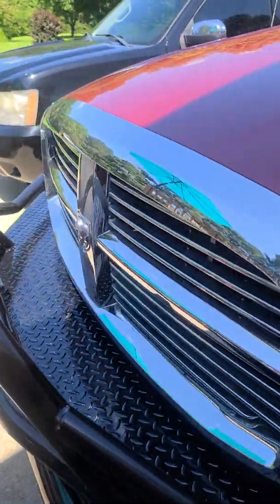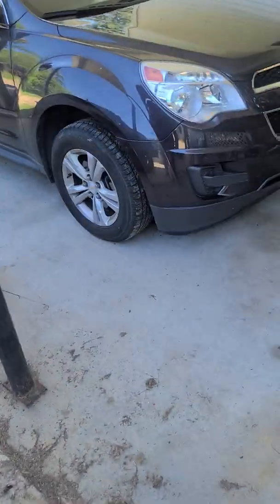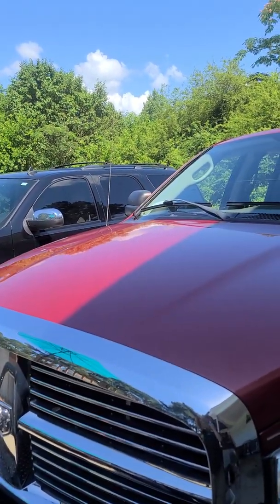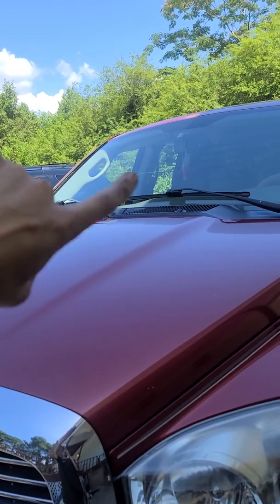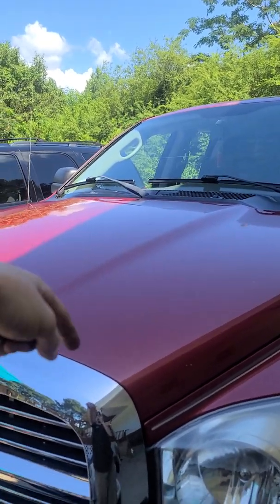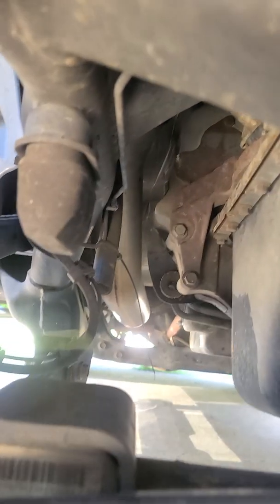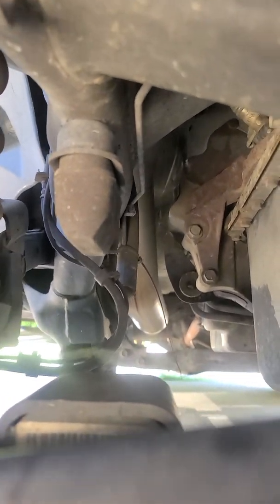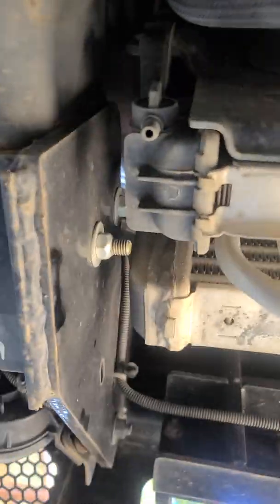When I bought this truck it's basically tuned and deleted. The only thing is the CCV was only like two-thirds of the way deleted — what I mean by that is they had the hose cut, plugged off going to the turbo so there's no oil going to the turbo, and then heater hose coming out of the vent going down. So that's coming out of my CCV — that hose with the black zip tie. The filter wasn't gutted, so I went ahead and took care of that.